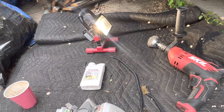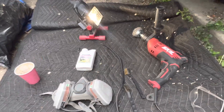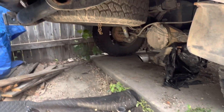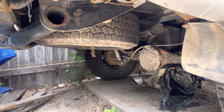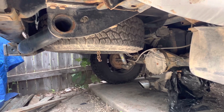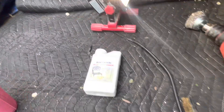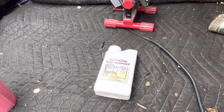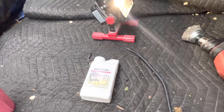So one frame rail down, I'm about three or four hours in, and it's going to take a while to do a good job. The key is in the prep — if you don't prep your surface well, this isn't going to work well. Spend your time carefully prepping and don't get too excited to paint. If this was helpful, please like and subscribe, comment. I always enjoy comments and questions, and most of all have fun out there. Thanks everyone.